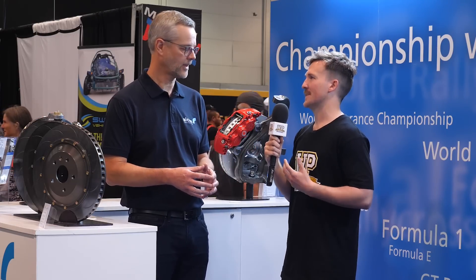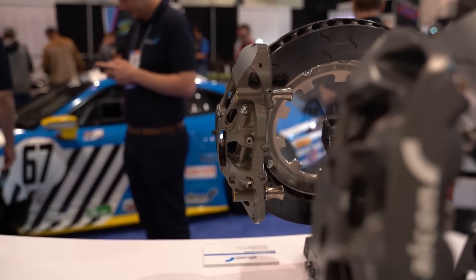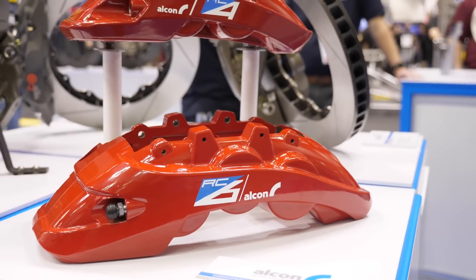Knockback also speeds up wear. It's pretty unconfidence-inspiring at the end of a long straight at high speed for the driver. A lot of drivers will give the pedal a safety tap just to know it's there — that's what that's about. It will destroy a driver's confidence if they don't know where their brakes are actually going to start generating pressure.